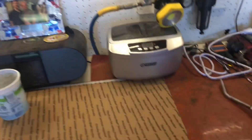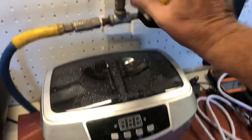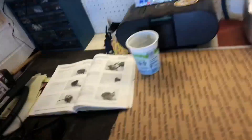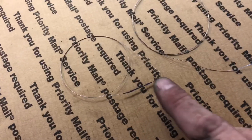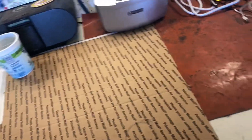I've taken the carburetor apart, cleaned it up, put it back together, and put it back in the bike. I wanted to show a couple of things I use. Of course, I like the ultrasonic cleaner with the pine-sol and water mixture — that heats up nicely. But when I don't use that, I like carburetor cleaner in the spray can and guitar strings, which are just small hard wires you can feed through the jets and passages of the carburetor. Along with compressed air, that works pretty good.